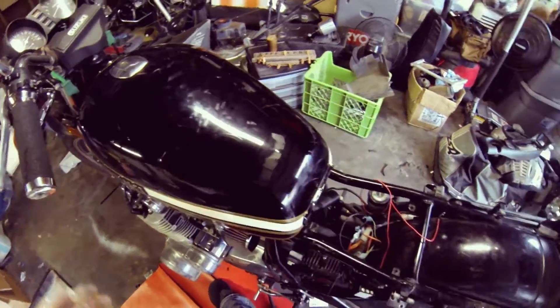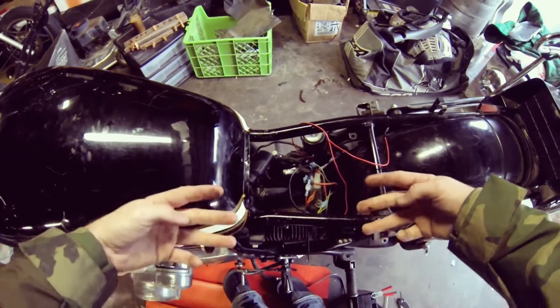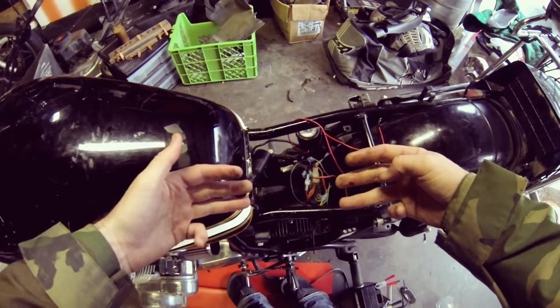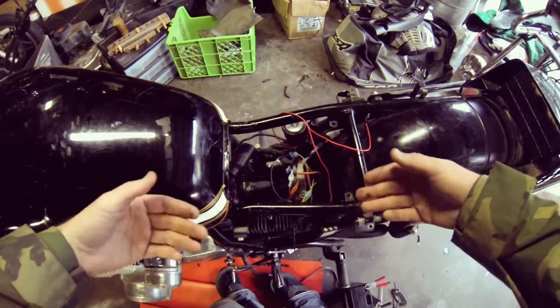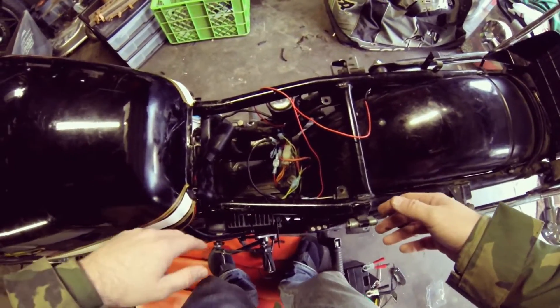If the headlight's off because it's not drawing power from the battery — the bike's running right now because I'm warming it up — just so you can see how this works: the headlight is on/off. I turn it on, you can obviously see that the headlight works. Same thing with the dash lights, same thing with the tail light. Now one of the things people do is disconnect that yellow wire running up to that switch and hardwire all three coils together so your headlights are running full time and your bike's charging correctly. I didn't do that yet because I figured I wasn't drawing too little power — I was getting too much of a charge.